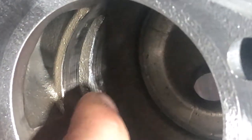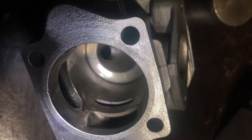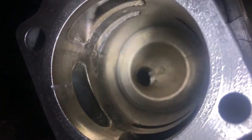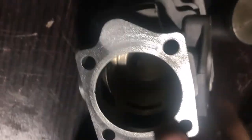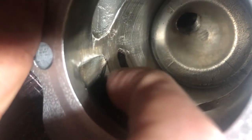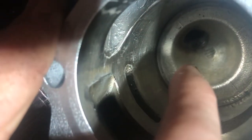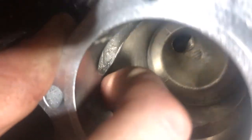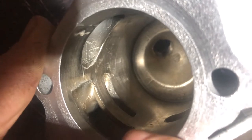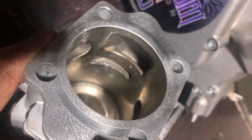That's bad because now that it's taken out the corner, I think it's going to start taking out chunks in the center of the port rather than just shavings on the edge. It's really hard to avoid with the Phantom 85 because the end gap has to be somewhere that vertically doesn't pass over any ports. There's not much room - it's got to be between the very edge of the top exit of the transfer port, working with only about a five to seven millimeter wide vertical line. I was having no issues on the other port, only on one side.